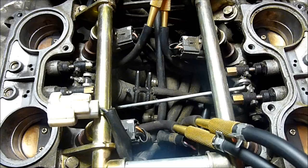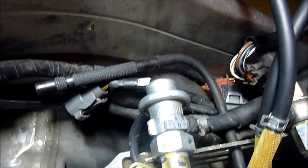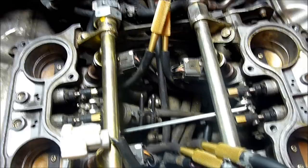The other important thing to do is to make sure any loose vacuum hoses are plugged — that means the flapper valve vacuum hose right there. I've just shoved in a punch which has a tapered end into that hose to seal it up. You could use anything like a bolt or a large nail, as long as you seal the vacuum. If you don't do that, what will happen is this particular cylinder will require massive amounts of adjustment to get the synchronization right. And then when you button everything up and plug that hose back into the flapper valve, it'll be a poor synchronization because this one will go way out again. So make sure all loose vacuum hoses are plugged and that you have no vacuum leaks.